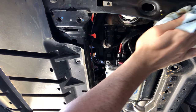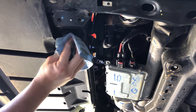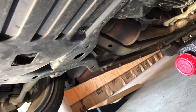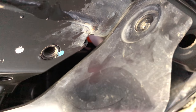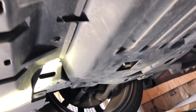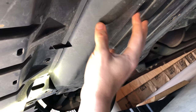Go back and clean up any more of the oil mess, then get that panel put back on. When putting the panel back on, you've got those two 10 millimeter bolts in the back, one push pin, and three 7 millimeter bolts. The easiest approach is to get the push pin in place first, then pivot the panel underneath — remember it goes underneath the front panel — and then bolt it up from there.